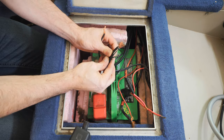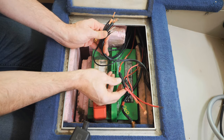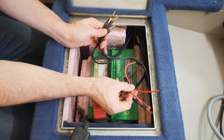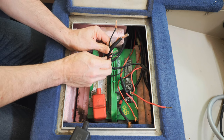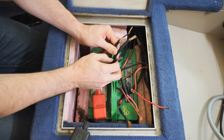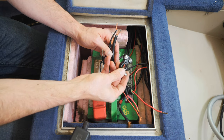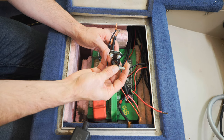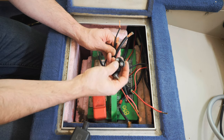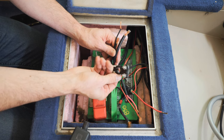Okay, so that's off. Now you can see how many cables we have here — five negatives and four main wires. If I wanted to add more electronics, I'm going to have a ton more wiring. You can see these just pop right off super easy — you can see how small they are. Not ideal. Didn't work the way I wanted. It's just too much wiring for this little piece. So if you guys are looking at this kind of terminal, forget it — no bueno.